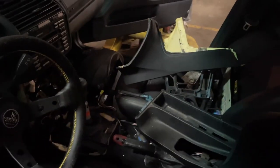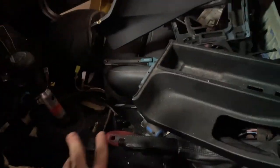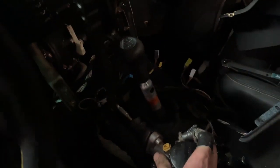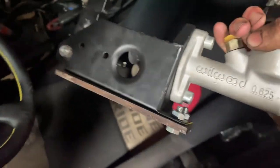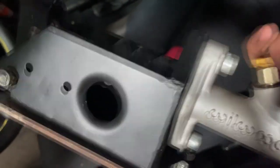Now is the fun part — I've got to figure out where I'm going to throw this handbrake. Things have escalated. Looks like I'm going to have to mount it here, so I went ahead and took the center console and everything apart. I made a quick plate that the handbrake is going to mount onto — these bolts are going to be welded on the back side. Then it's going to sit something like this. I'll also put a support on the side so it doesn't wiggle side to side, and when that's done I'll bolt this back in and start making the first line off the master.